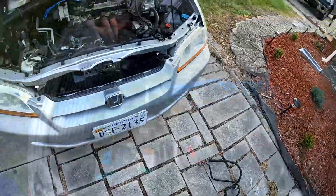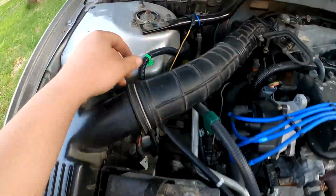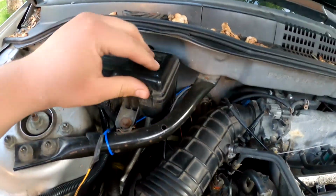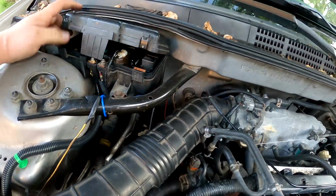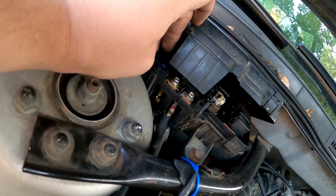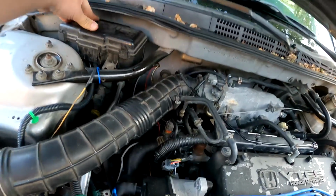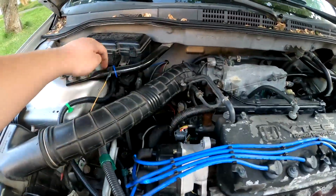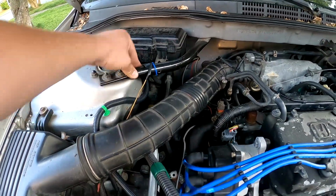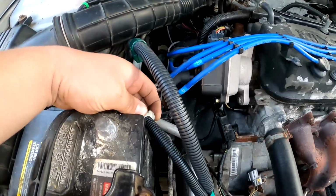Now we'll go on to installing the new one. As you can see, we got the new cable on. We clip it, take this back off. We got the screw in, which is actually an 8mm. I do apologize. Okay, you clip that back on. Got this going. You route it through underneath this way, the shock tower bar. Basically, you underloop it, and run it through this clip that it comes with.